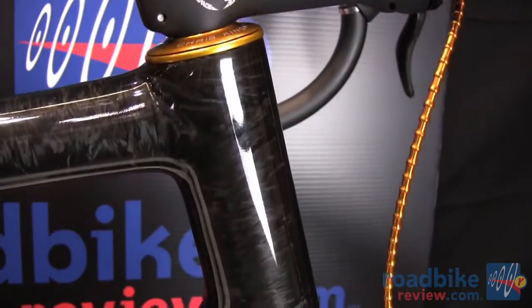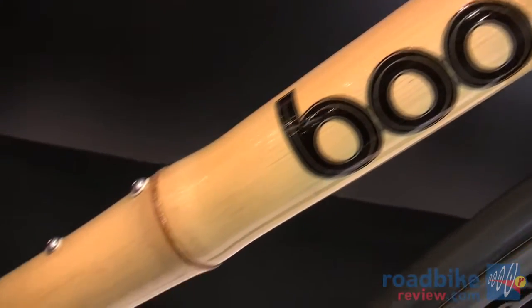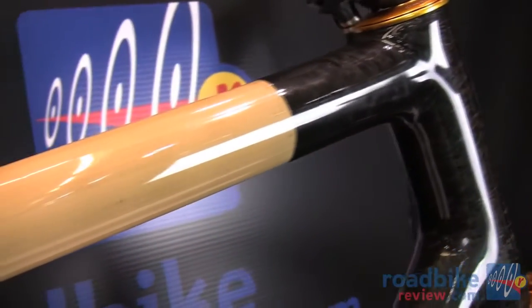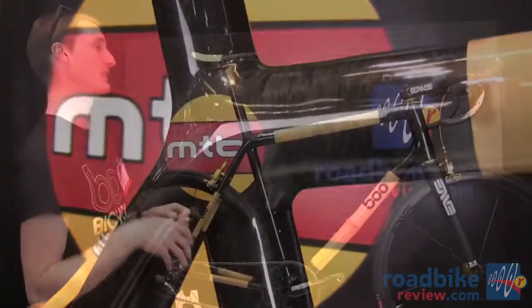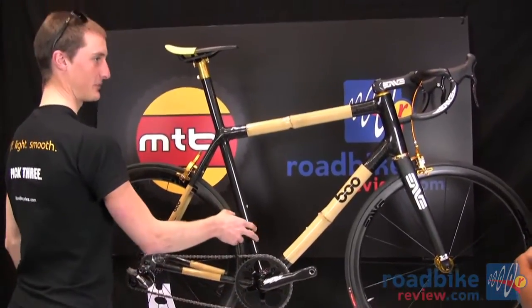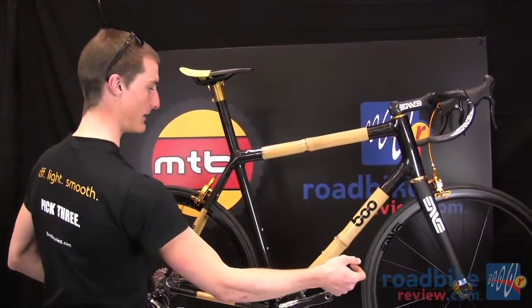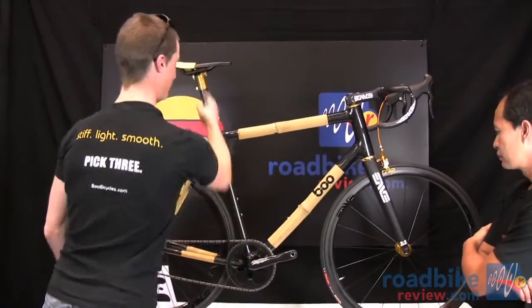It's the perfect synthesis, just for the ultimate performance, but still preserving a really good ride quality. The goal was to always preserve ride quality. The bamboo absorbs high-frequency road vibration really well. Carbon fiber absorbs vibration too, but it's a lot stiffer — that's its strength. We wanted to make the seat tube carbon because the lateral bending stiffness is actually the most important aspect of the seat tube. So we made the entire seat mast out of carbon. But then the road vibrations that travel through the wheels, through front and rear dropouts, are really isolated by bamboo before it ever gets to your saddle.